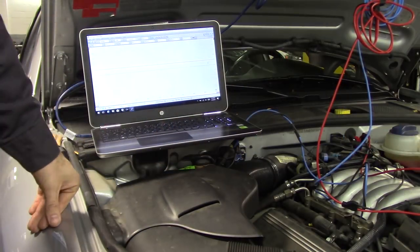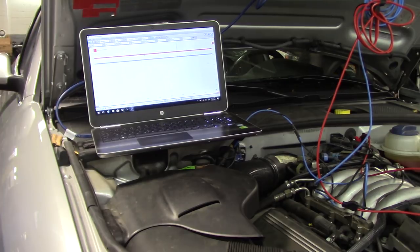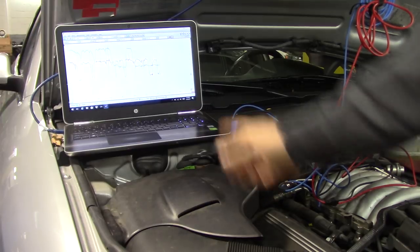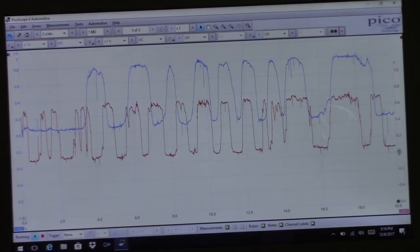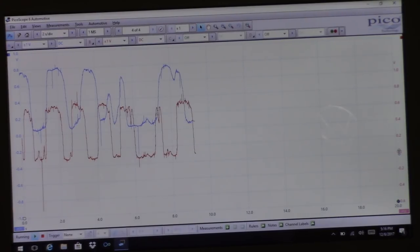All right guys, got the new O2 sensor installed on the Bank 2. Let's fire this baby up. So I'll let these O2s warm up and then focus you on there. So the blue channel, our channel A, is our Bank 1 sensor 1. And the red trace, channel B, is our Bank 2 sensor 1, which is the new sensor. Raise the RPM up a bit.